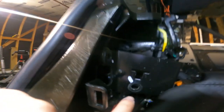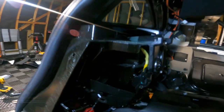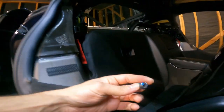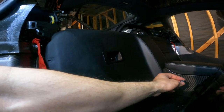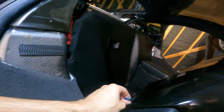I removed the belt — do you see? This is screw one, this is screw two, and I took off the top section screws. That's all — easily you can remove it. This is the belt. For the seat itself, you need T40 — you have four screws, left, right, and front two. After you remove those, you can remove the seat, but it is heavy, so two persons is much better.